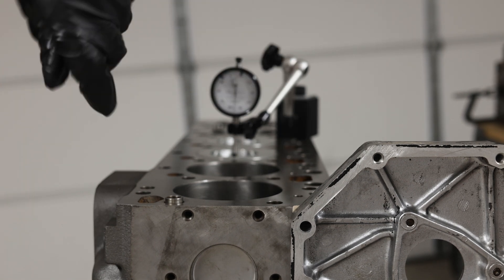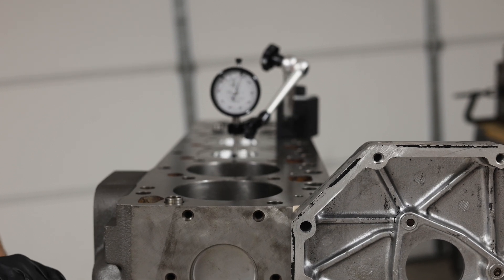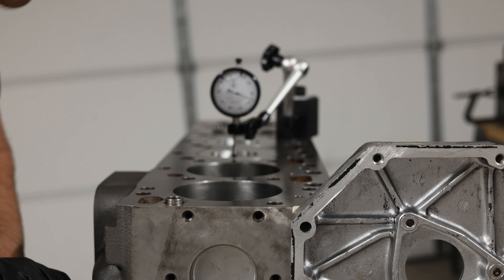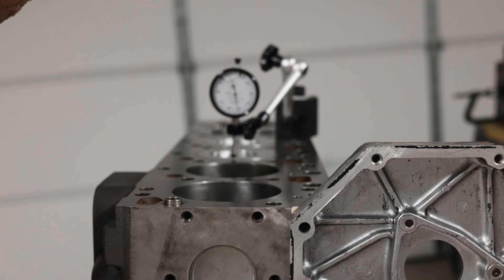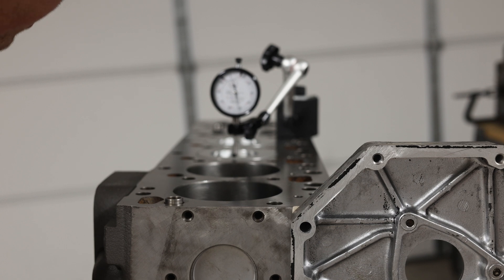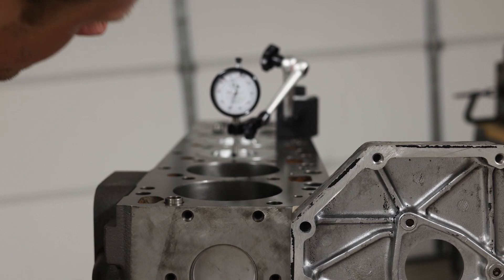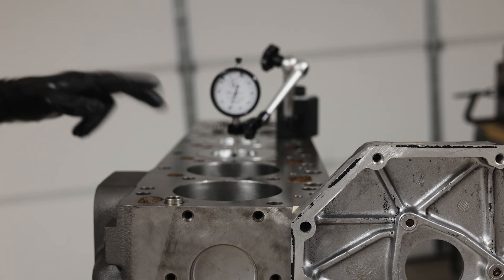So you can see here we're at about 56 thousandths. If we turn the engine over, it's going to mess with our reading. We've actually gone back down now. We'll come back to what I think is top dead center. We stopped at about 60. It's right there at 60, so we're aiming for that 60 if we can. We want to be as precise as possible. Real close to 60, so I'd say 59 thousandths. Right about there — that's where we want to be. So we know that we're at top dead center for cylinders three and four.